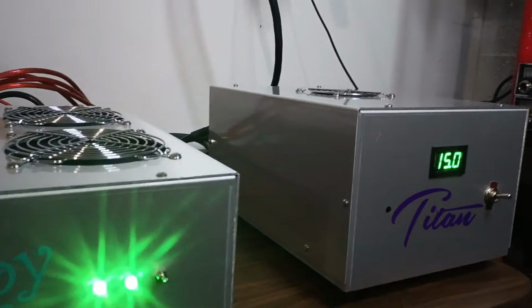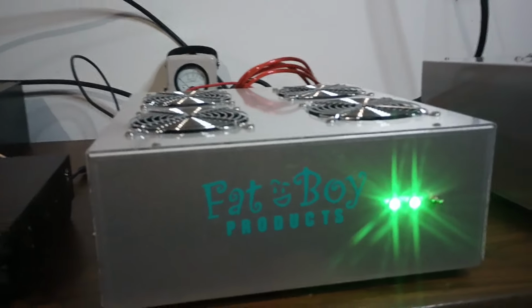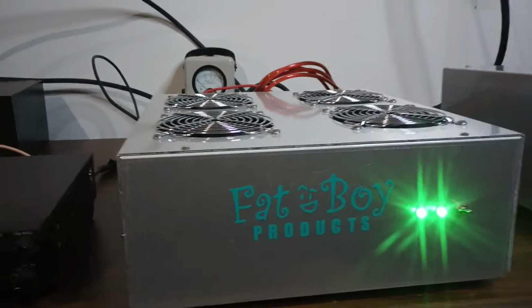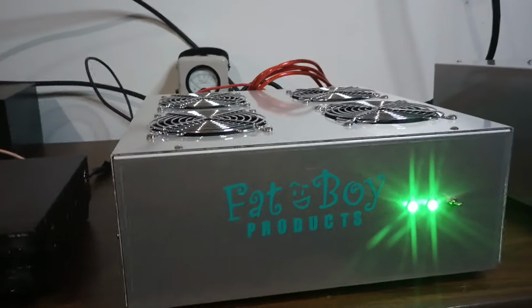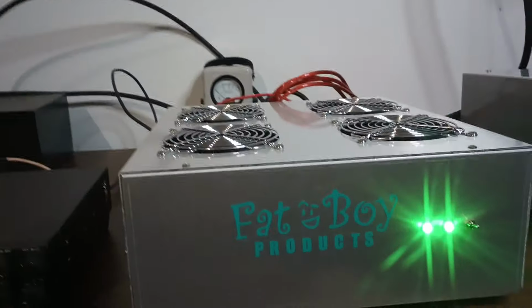The voltage is falling plumb out of sight. And you really want to run these C's at 15 minimum. So dropping down to 12 and some change, we're not doing this thing justice whatsoever. And we're feeding it, we've only got like 4-gauge OFC coming to it. So that being said, let's just do a quick test, make sure this thing's good to go before we get ready to box it up and ship it out tomorrow.